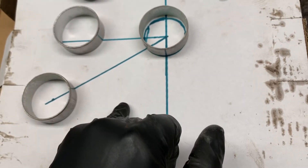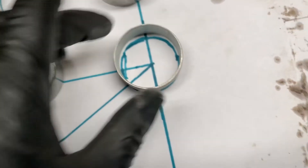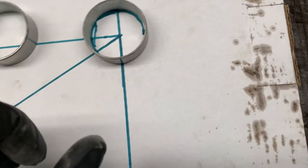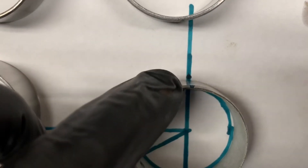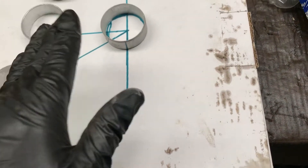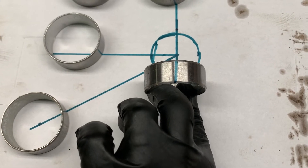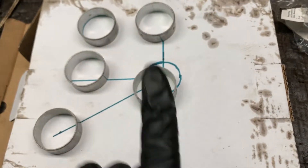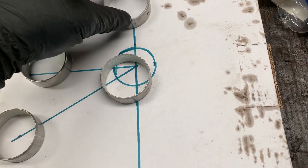Since we didn't draw that line, we've got 60 degrees here and 30 degrees there. I just centered up the bearing and drew the inside of it, then lined up the oil hole on that line and drew a line up the bearing. That will be our centerline so we can line these up. Looking from the top of the engine, we'll center that up — it's a little crooked, but the part we're interested in is right there — and that's going to point up at twelve o'clock as we push the bearing in.